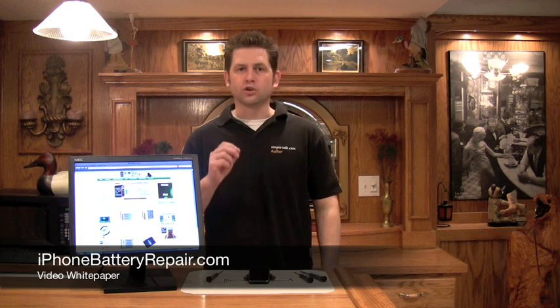Also, the new replacement battery can short circuit if the red wire touches an electrical ground or any of the other two wires on the battery. Do not remove the red wire heat shrink wrap until you're ready to solder the connection. This will prevent any accidental shorting. So let's go through some of the highlights that you'll need to know in order to be successful.